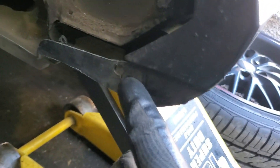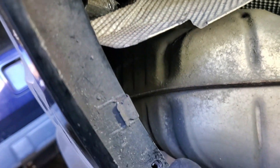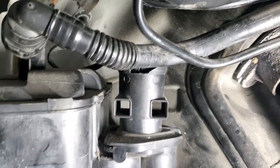You take a clip from there, a 10 millimeter plastic bolt from there, and then from there and there — there are about five plastic bolts and three clips total. Right here is our charcoal canister, located exactly where you fill the gas for the car.